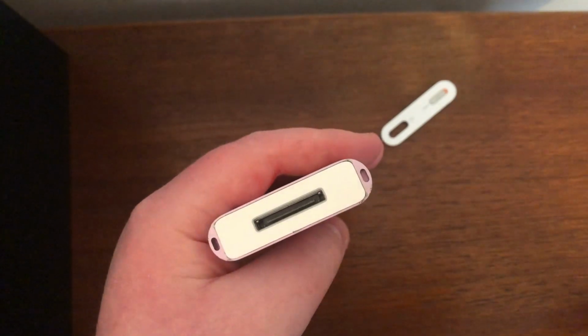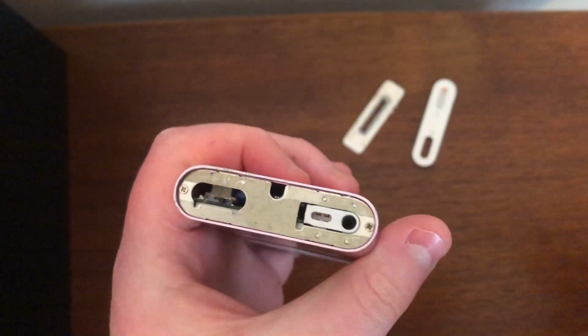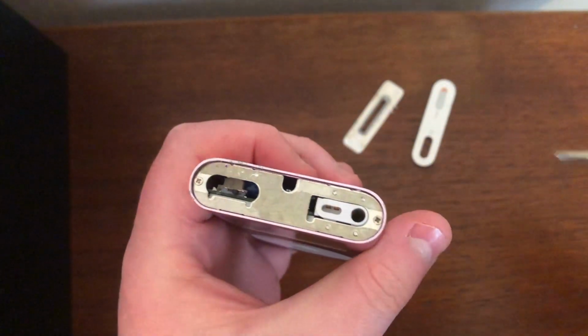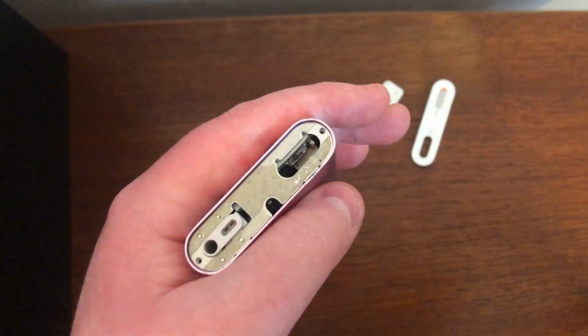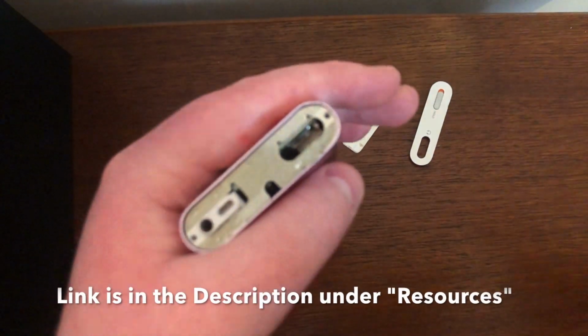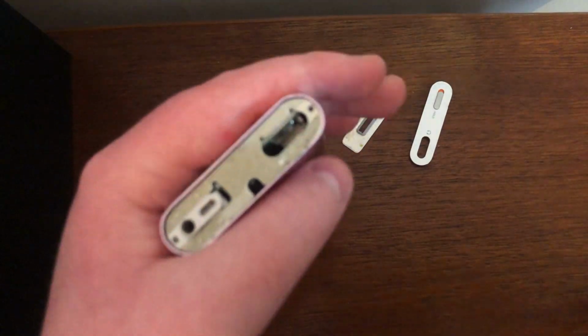What we've got to do next is take the bottom off. There we go. Very easy. So then what you want to do is take these two screws off the top of the iPod, then we'll deal with the bottom. Them screws are very easy to lose, so I would advise keeping them in some form of screw pot or container. I will leave a link below if you have a 3D printer to a 3D printed one I designed.